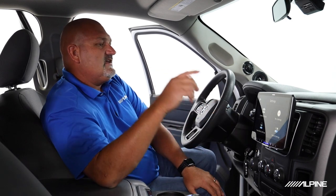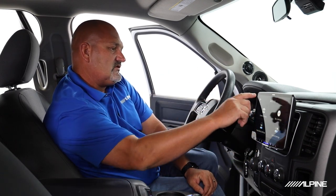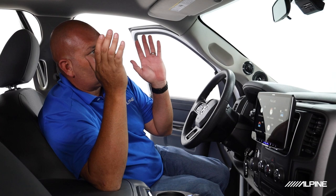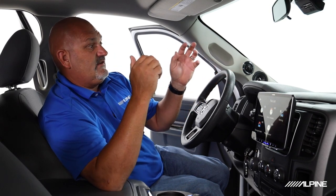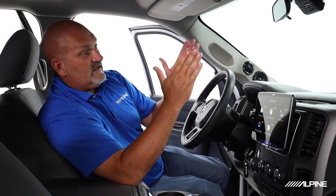Another cool thing is that there are separate buckets for your recordings, so they're very manageable. If you go into your file list, you see five different buckets. This recorder is always recording — it has a continuous recording bucket. It also has a continuous incident bucket, so if there's a collision or some type of impact to the vehicle, it saves that event in that bucket — taking 10 seconds before and 10 seconds after the impact and storing it there.